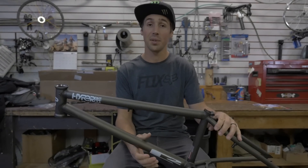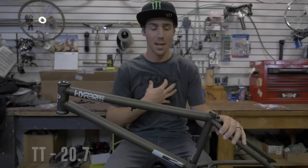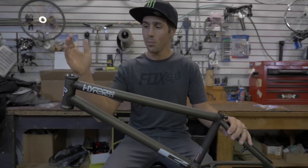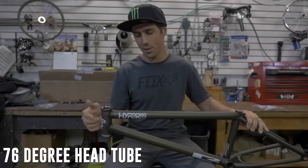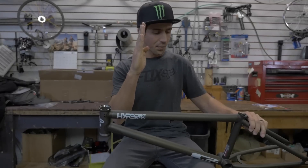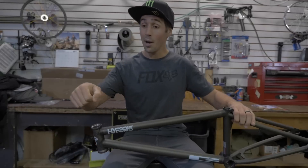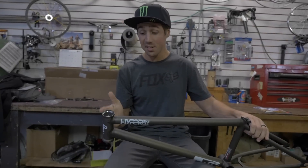As for the geometry, we'll start with the top tube. The top tube is 20.7 inches. I'm 5'10" and I think that's a good amount of clearance to do tricks and control the bike. The bike has a 76-degree head tube angle, which is pretty aggressive compared to a lot of bikes. The steeper the angle, the tighter the steering radius gets — it gives you a sharper feel, and also the ability to spin harder, tail whip, and bar spin more on a straight-up axis. So 76-degree head tube.